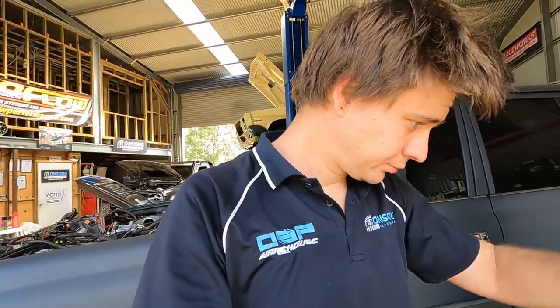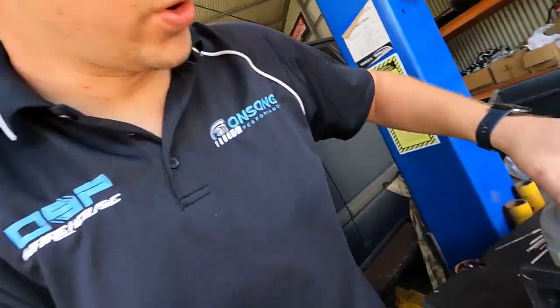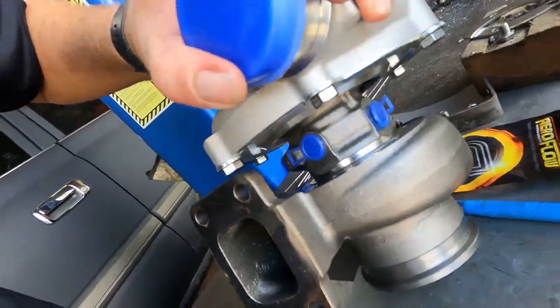So looking at this turbo housing where I'm going to put this port for this EMAP, I decided I'm probably just going to leave it for now. I'll prep and paint the housing. I'm also going to do the core. I'll mask up and paint the core. So I do have a new Turbosmart beanie to go on this turbo, so it will have a heat beanie, but I really want to paint it just to protect it from corrosion. They still are prone to corrosion underneath those beanies if you're not sealing properly, so I want to paint it.